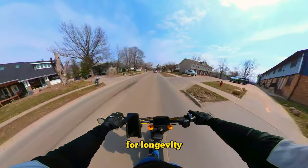We can talk about some of the upgrades I've done to this. I posted the TikTok video about it, but I'll just include it in this review video to make it easy for anybody who buys a scooter. The stuff that you're probably going to upgrade includes these solid handlebars, Spank Vibracore handlebars. They have dampening in the middle here that reduces the amount of vibration in the handlebars, which, if you ride scooters a lot, you know usually goes into your arms. It can fatigue you pretty quickly on scooters that have poor handlebar setups.